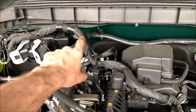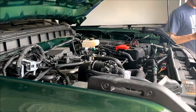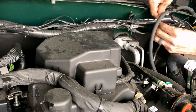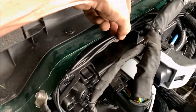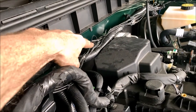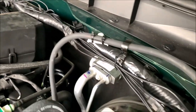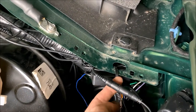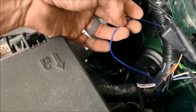The last thing to finish is wiring up everything in the engine bay. My shortest wire ends about right here, so I'm going to have to run the wiring harness all the way over there, and I'll try to get the driver's side to meet up too so everything looks even. Just finished running all the engine bay wiring. Here is where my connector with all eight lights is — it ended up right dead center, which actually worked out okay. Here is the little control module, zip tied right underneath this little hole. Here is where it's connected to the power and ground source and the switch. The little reverse light wire, I did not connect to anything.